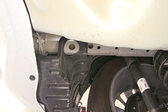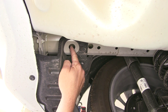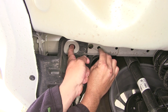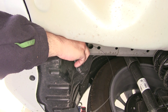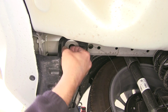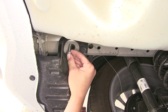Here on the driver's side, the process will be the exact same for the rear attachment point, but our forward attachment point will get fed through the access hole of the rear attachment point. So we're going to put our forward hardware in place first. We'll take the pull wire, feed it into the attachment point, and then out the access hole. There we'll slide on our block, thread on the carriage bolt, feed the block into the frame first, followed by the carriage bolt, and use our bolt leader to pull them into place.